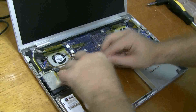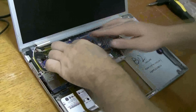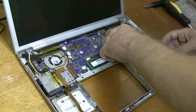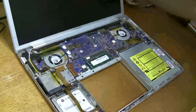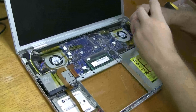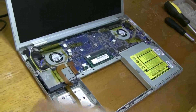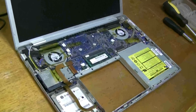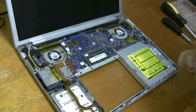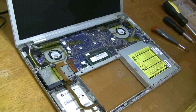The hard drive and the express slot and then the battery should do it. Kind of make sure everything's routed in a pretty way, and put this back in now. For the DVD player, the Torx is in the back here. And the longer Phillips goes on this side, and the shorter Phillips right there. There you go, you're getting there.